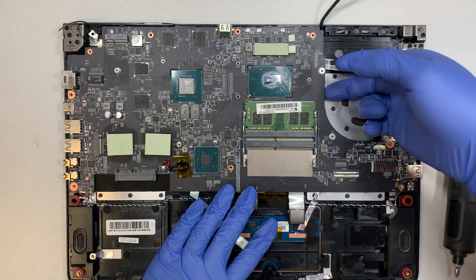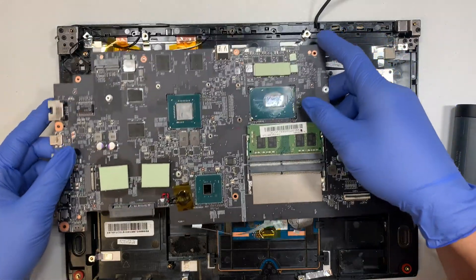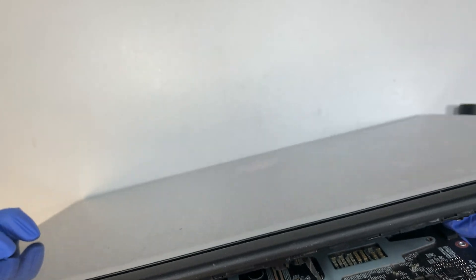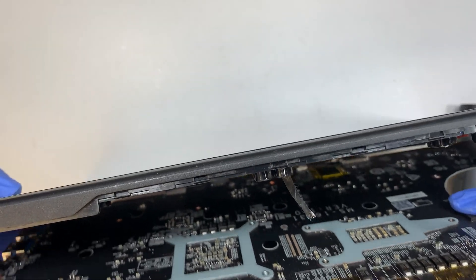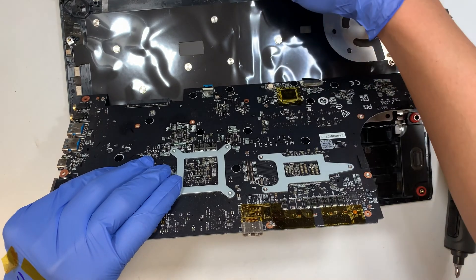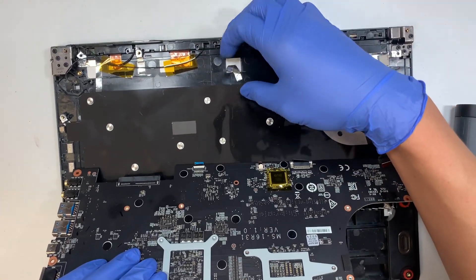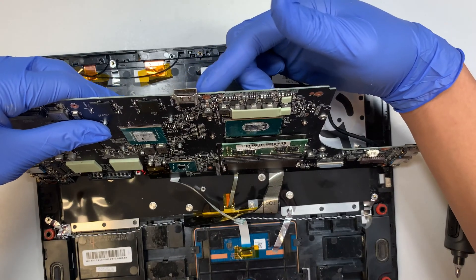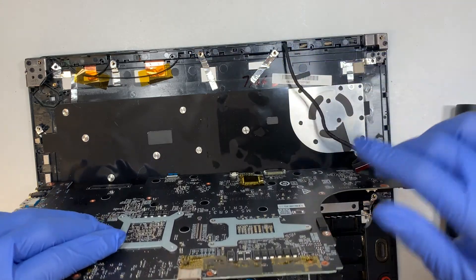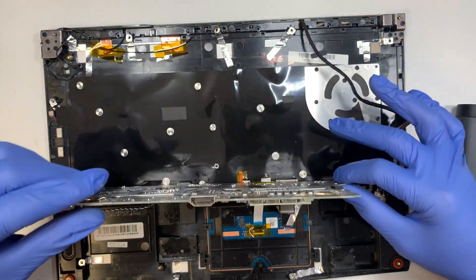Let's see if the motherboard can come out at this point. It looks like the motherboard is ready, but something is still stuck. You can't pull the motherboard until you know what's going on. It looks like there's an aluminum tape that's taped onto the motherboard at that corner — it's more for grounding purposes. There's no cable attached. Once I remove that, with three screws removed, you can just tilt the motherboard towards yourself.